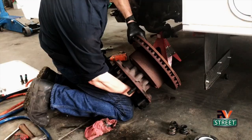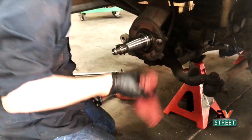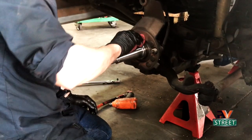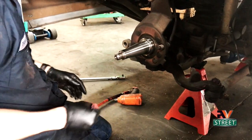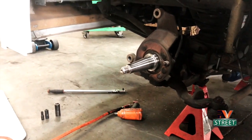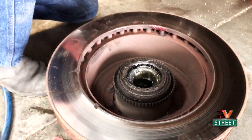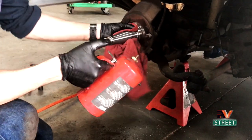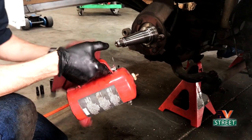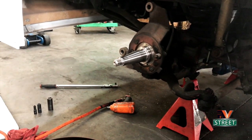This is not going to be for the faint of heart - that's probably about 40 to 50 pounds. This is really why I brought this in. The Ford spec is to repack the bearings every four years or 60,000 miles. Our coach is going on 10 years old and has 37,000 miles. I was really concerned that we didn't have the mileage but that grease is 10 years old. I was worried it might have gotten cakey and not be lubed correctly - if that starts to burn I'd be looking at replacing the spindle and everything.